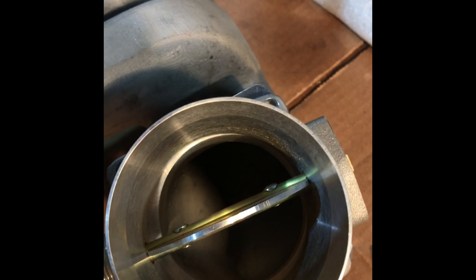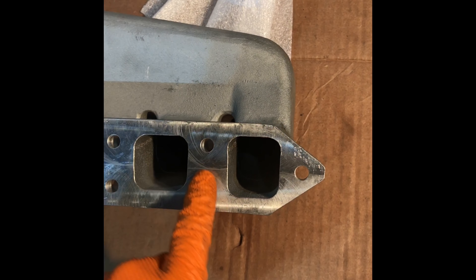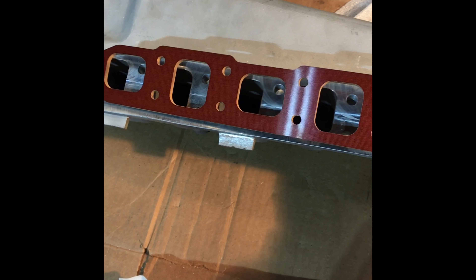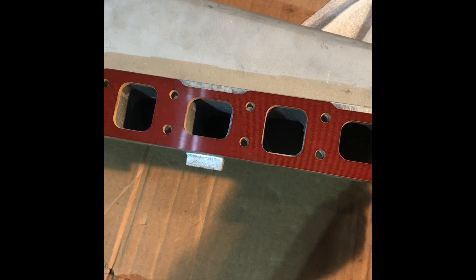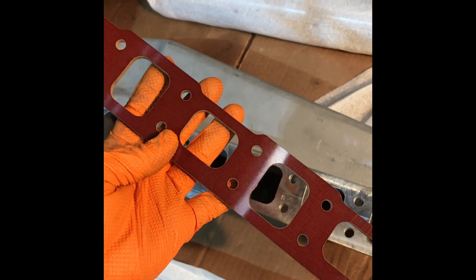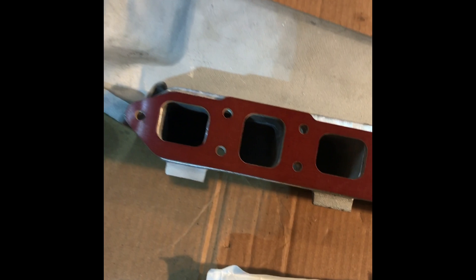I think this is a 74 millimeter — I'm gonna have to take it to the machine shop so they can port match it. We need the flow for the high. Most of you guys already know this, but the stock intake manifold has four rings around each runner for a perfect seal, and in this situation we won't be able to use those. So I got a thermal intake manifold gasket from Poland, from Krakow — this cost me $50 with shipping.